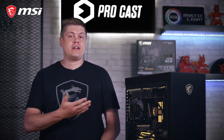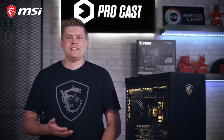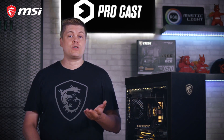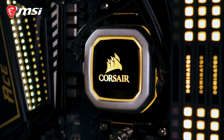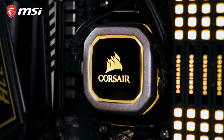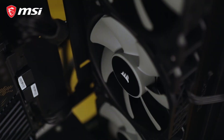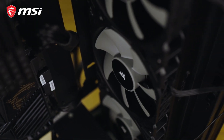Overclocking the AMD Ryzen 3900X will generate quite a lot of heat, so controlling core voltage is important. Remember, more voltage times each of the Ryzen 3000's cores equals a lot more heat. To handle this, we'll be using a hefty Corsair H150i Pro RGB 360mm AIO liquid cooler. We would suggest using at least a 240mm radiator for long-term stable results.